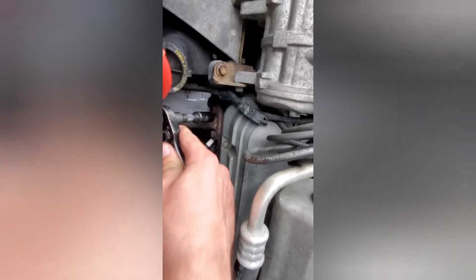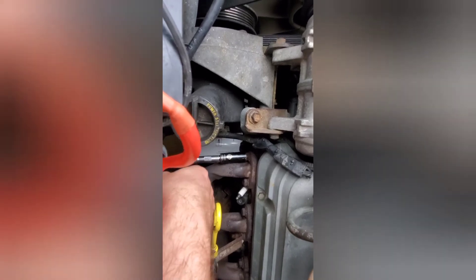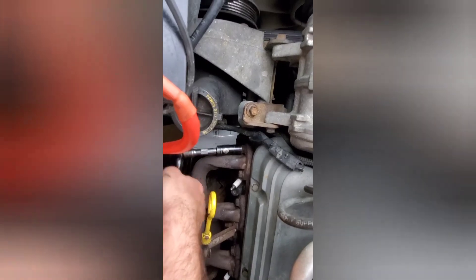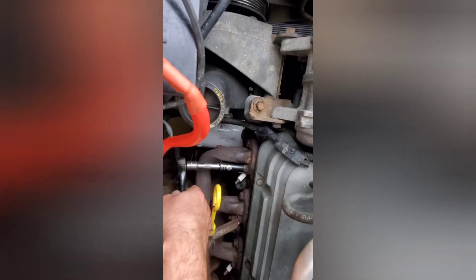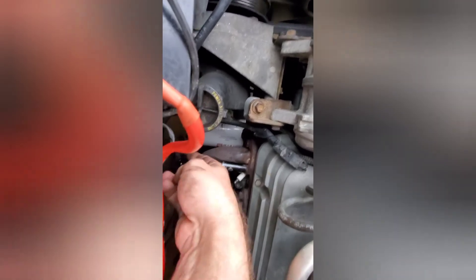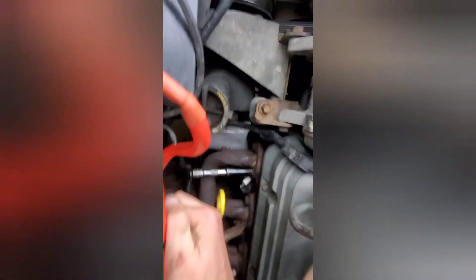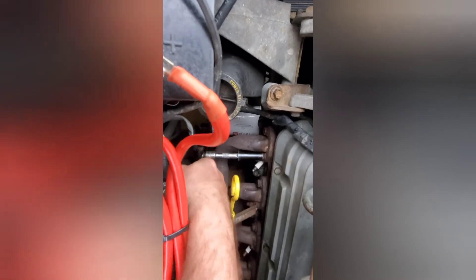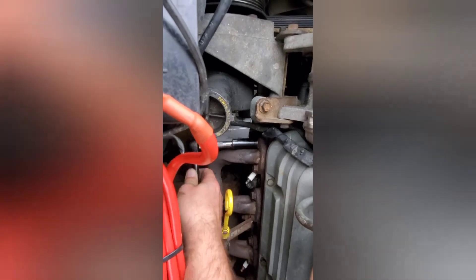I accidentally had the ratchet on tightened, so everything is really a lot harder with one hand. Both of these primaries — right where it was leaking — I tightened up that front one, and I'm still tightening up the secondary one. I think what we're gonna do is just go through, make sure everything's tight, throw the spark plug wires back on, and see if it still ticks.